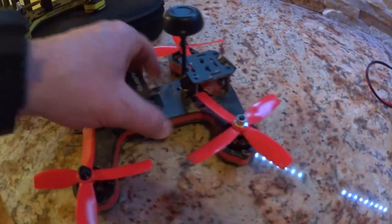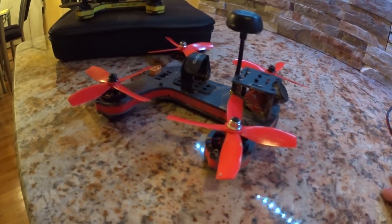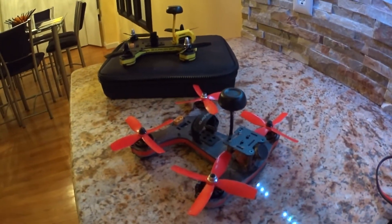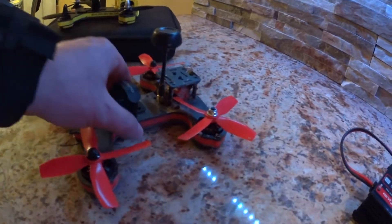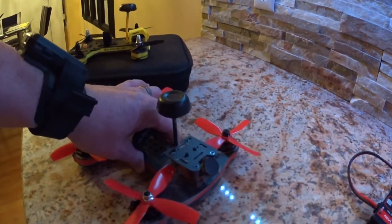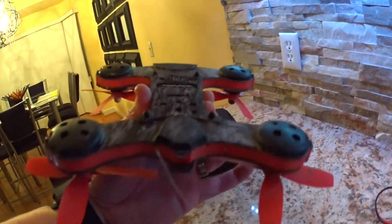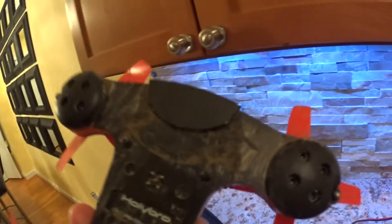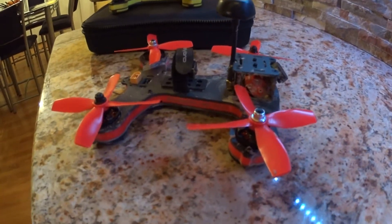Let's get to the dirt. I'm going to have about an hour of disassembly, rinsing off, and cleaning. I had thrown a couple of 3S packs through here. The last 3S pack I put in — I was just doing 3S today, didn't have any 4Ss charged — was a pack that hadn't been charged in a while, so I charged it up right before going to the field. Obviously it could not handle it and had a big voltage drop mid-flight. I was coming in for a landing because I noticed it wasn't giving the punch, so I knew there was an issue. The voltage crashed and it literally fell from the sky right into some mud puddles and skipped across them. The battery recouped and it lifted out — I was able to land it in the grass and keep it from getting any more damage, but there is mud everywhere and I'm going to have to disassemble the whole thing and wipe it down.